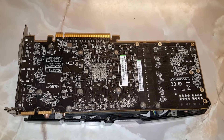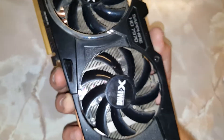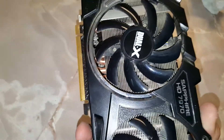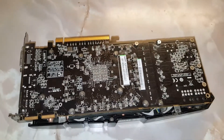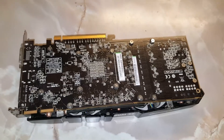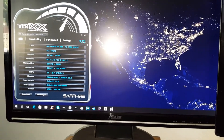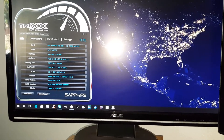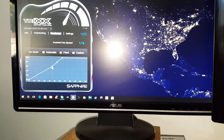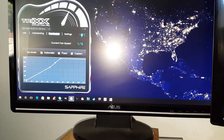I did not realize how bad the thermal compound really was in there — it was really, really bad. Now this thing has got a fresh patch of thermal compound, the cooler is all dusted out, the board is dusted off, and it's gonna be amazing. We got her all plugged in and she's running about nine degrees cooler at idle, which is amazing. I'll take it.